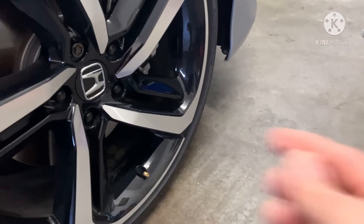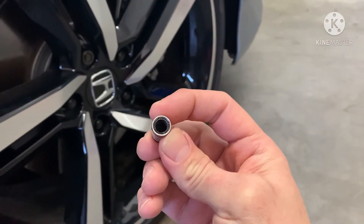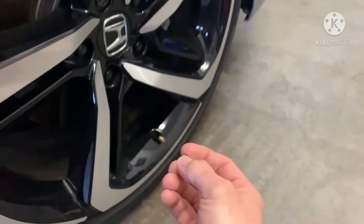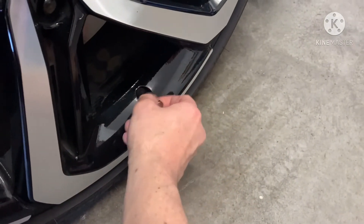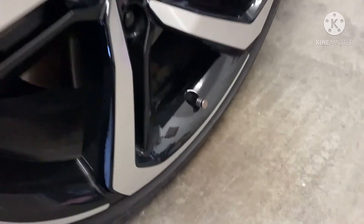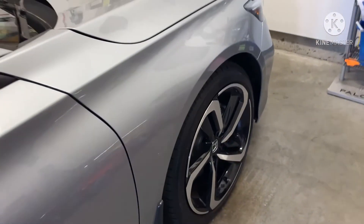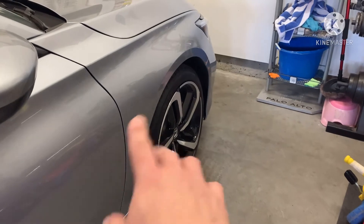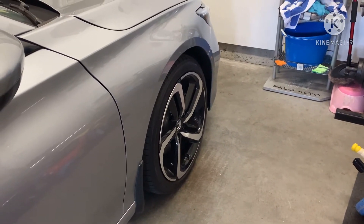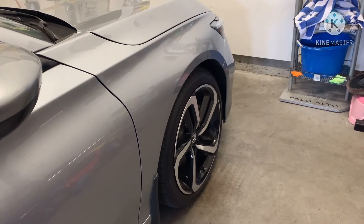When you try really hard — some people have to use a wrench — it's gonna snap the valve off, so it's gonna cost you a lot more to get these replaced. It's very simple: when you're wanting new caps, just type in 'TPMS safe wheel caps' and they'll be sleeved like this, or just use plastic ones. I've heard of so many people that ran into problems and had to get new valve stems put on — it can add up, especially doing all four tires. Just the labor to take the wheel off is way more than the few bucks you spent for the cap.